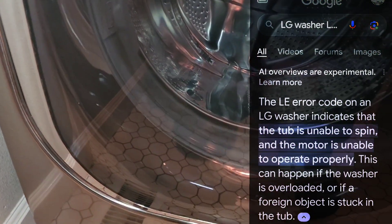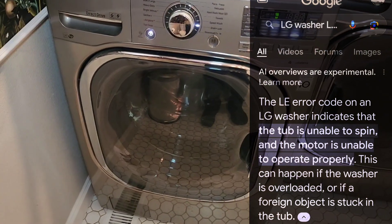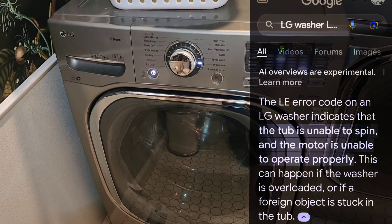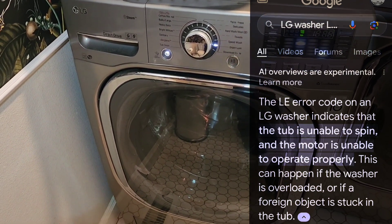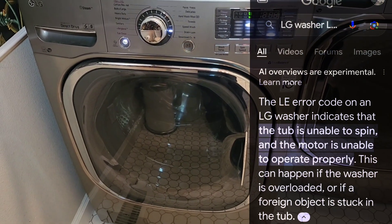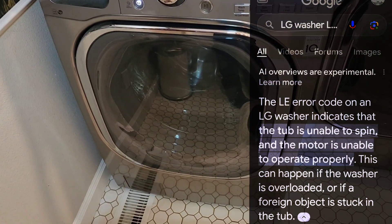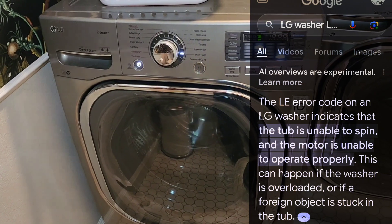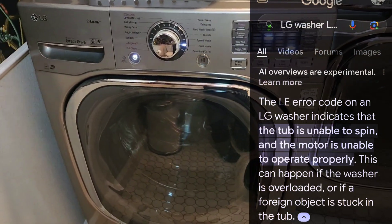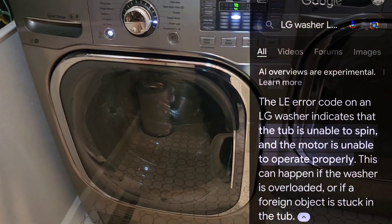The savings is what the repair cost would be. This is a five-year-old unit. Pricing the repair out — even if it was a simple Hall switch, that's all this repair could be — but most likely you're going to have to replace the stator and the control board, and that board is no longer available. Retail purchase of a new unit is recommended. It's a pretty machine — you'd think it looks too new to be having these types of problems.